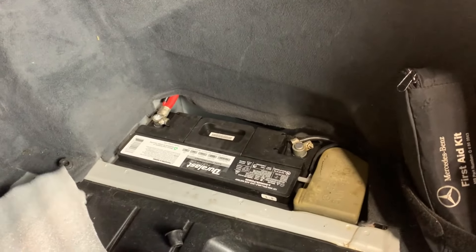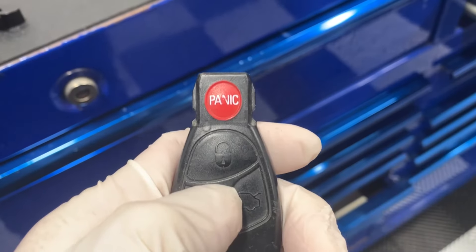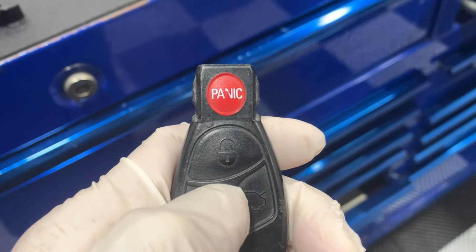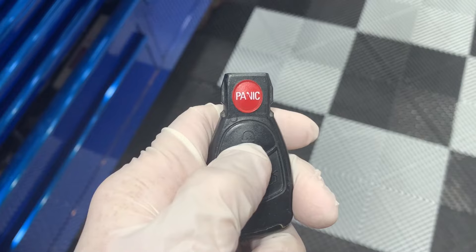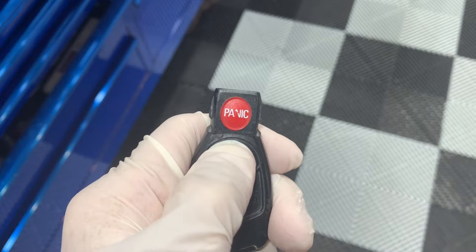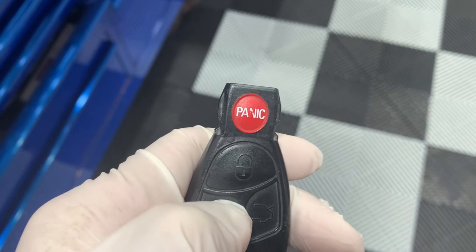If the car doesn't start and there's no lights on the inside, then you're just going to want to check your battery — it could just be a dead battery. I removed the batteries from the key to show you how to check the batteries in the key. There's no batteries, so if you push any button, the little red light right there is not going to light up. I've installed fresh batteries, so when you hold the key, see the flashing red light? You hold the button, it indicates the battery's okay.